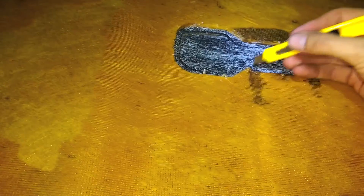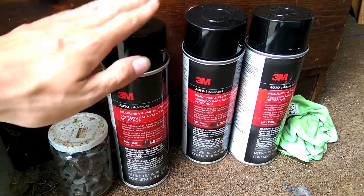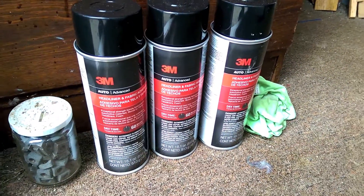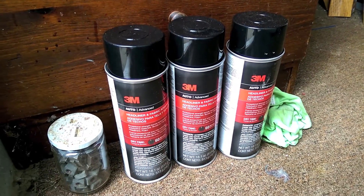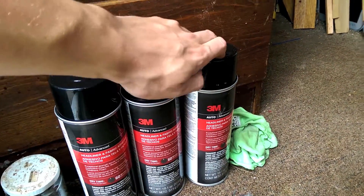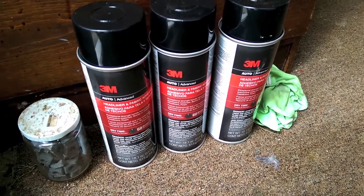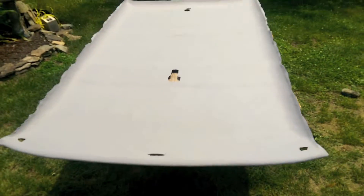Here's the headliner fabric adhesive — the 3M stuff that came with the kit. I needed a total of three cans and I used every single drop of all of them. I don't know if I put it on a little too thick, but one can just isn't enough at all. Be prepared to at least get two if you buy that kit online. Make sure you know if there's an auto parts store nearby with something similar, but I needed three cans with how heavy I was putting it on. Sorry I had to cut short last night — bugs were getting terrible.